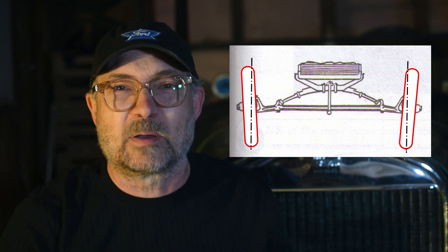Steering effort and bump steer should all be the same. I weighed a complete Model T wheel with rim, tube, rubber strip, and tire, and compared that with a complete Model A 19-inch wheel, and their weights were identical. So no concern that the new wheels are heavier or lighter than the previous ones, and the rolling diameter is essentially the same also.